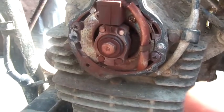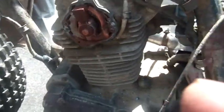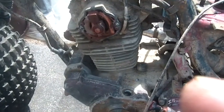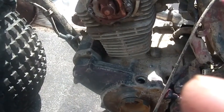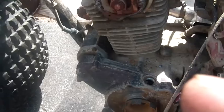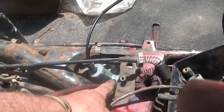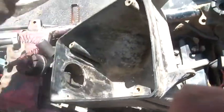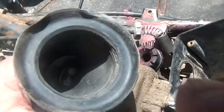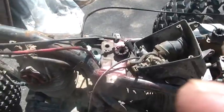I'm not thinking this thing jumped time. The reason I started to question my conclusion is I have not had one of these motors that have jumped time yet. I've had 200X motors - quite a few of them - that have jumped time, but never one of these. I did do the leak-back testing: I pressurized the cylinder at top dead center and had air coming out the carburetor. I think the reason it did that is they ran it for a while without an air cleaner.